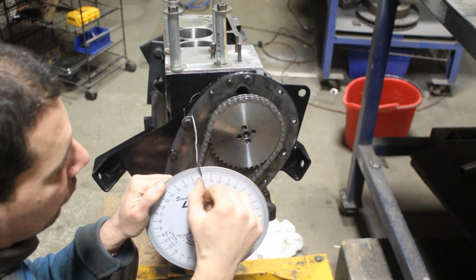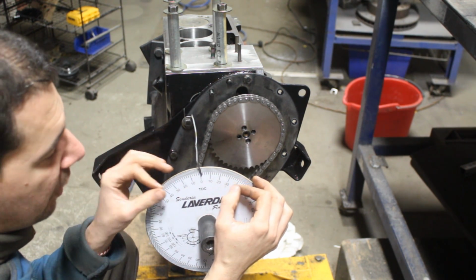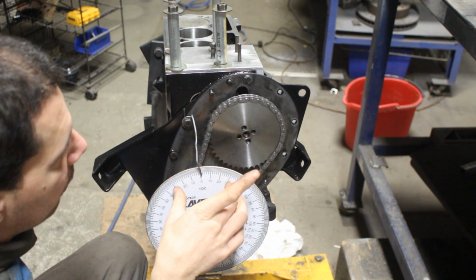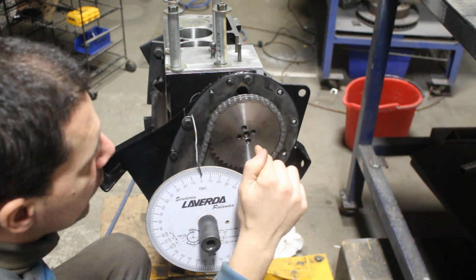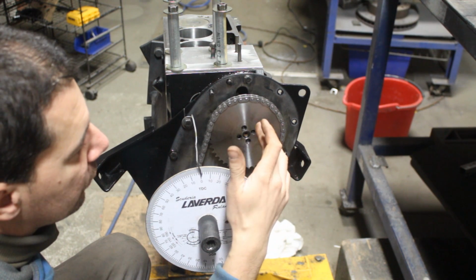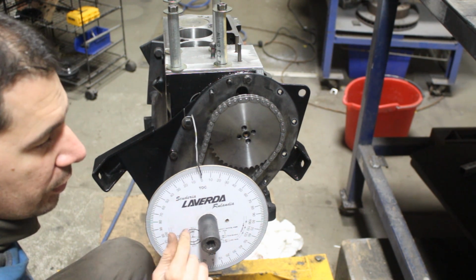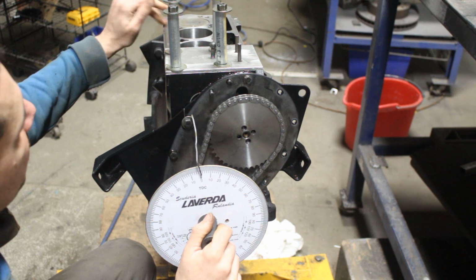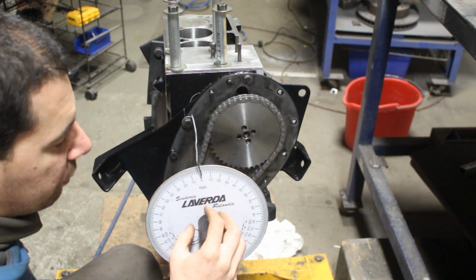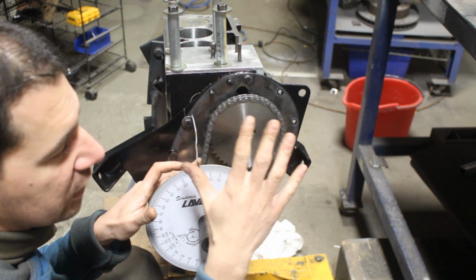This overlap is when the two valves are a little bit open, both of them. And because it is 25 before and 25 after, this means that at zero, the two valves must have the exact same opening. They would be exactly equally open at top dead center. So we are looking for this position of the camshaft in which the two valves are equally open, and some people call that top dead center of the camshaft. And then we have to find the top dead center of the crankshaft, but the true top dead center, not the approximate top dead center where we stand right now. We need to find the true top dead center and then match the true top dead center of the crankshaft with the top dead center of the camshaft by attaching the chain and fixing them at this position.